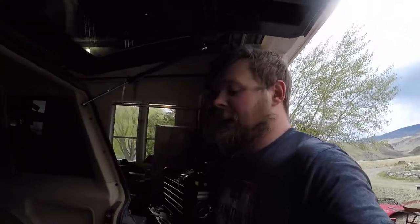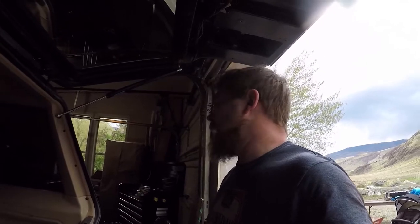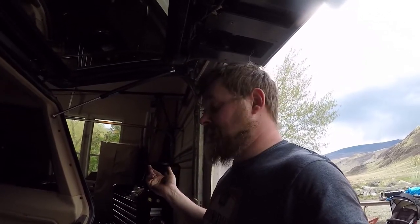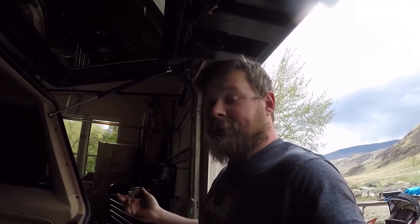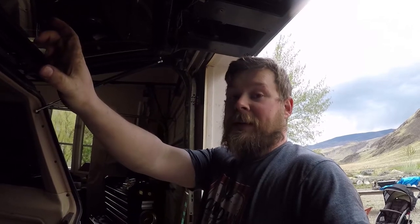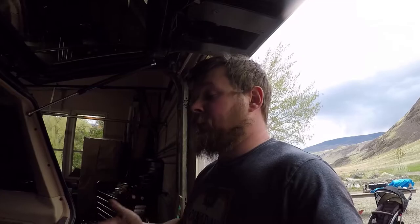So, I would really hate to get the transmission back in to find out I need to replace that flex plate and the crank positioning sensor. I don't think I'll need to replace it. It looks like it's good, but we'll see if we can get it fired without requiring us to install the transmission. I might just have to hold it there where it sits on the factory position, and then hopefully it counts the teeth and then it goes whoa and fires up to life and just idles perfectly, which would be excellent. But it might not, we don't know.